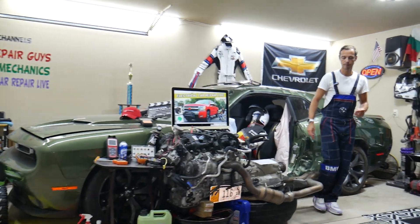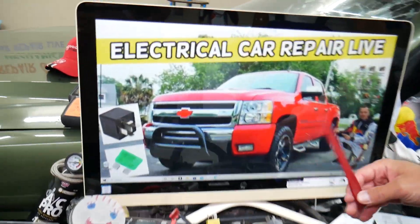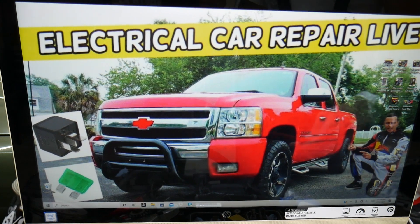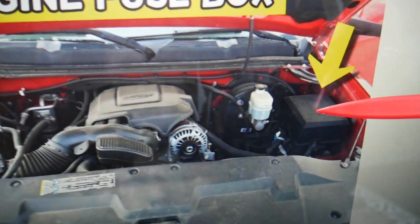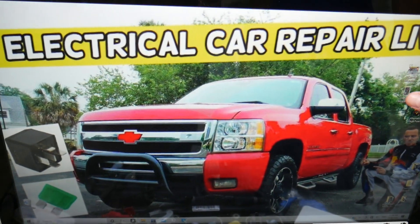The EVAP fuses — where you can expect to find them. We'll demonstrate on this generation Chevy Silverado right here. By the way, you have three different fuse boxes in this truck and today we'll be working with just one that's right under the hood. Open the hood, facing the engine on the right side, you have a fuse box under this cover here. Go ahead and open it, and once you do that, you'll find the main engine fuse box with a layout that looks like this one here.